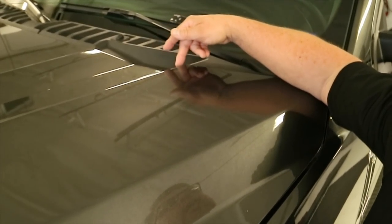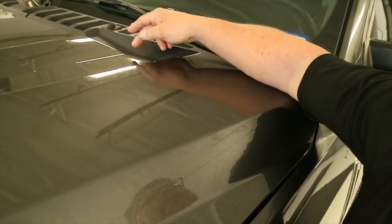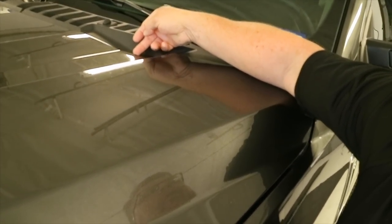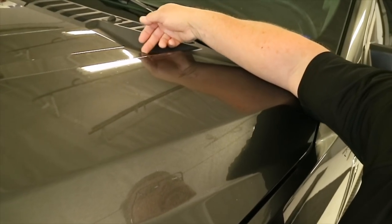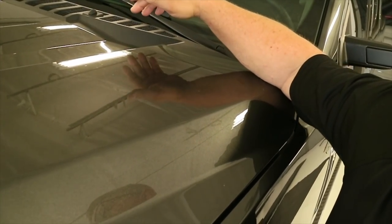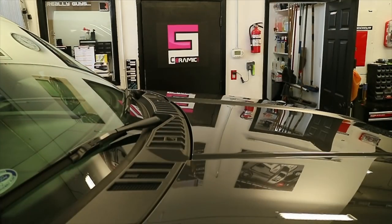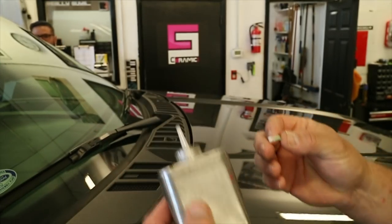What I usually do is put a little bit of adhesion promoter on the back of the hood so when I go to swipe this up and get it to suck down and lock it, it stays locked and doesn't pop back up leaving an air gap. On the F-250 it's pretty much the same — this valley wants to pop back up, so I put adhesion promoter on the leading back edge of the hood right along through here, and that helps lock it down after you squeegee.